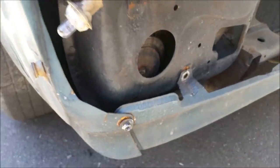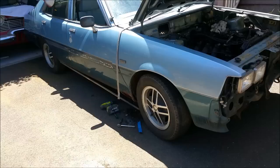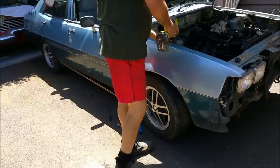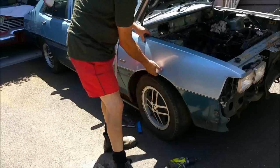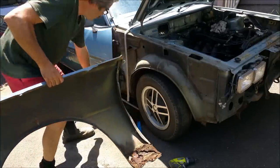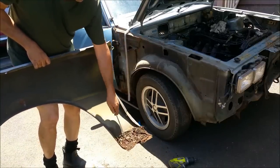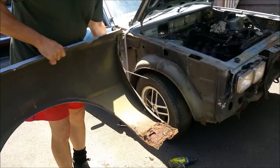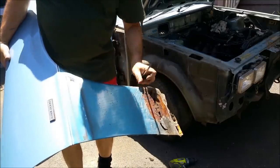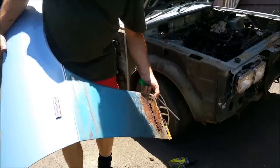More Tiger Yellow - so this Tiger Yellow car has obviously been in a biff and the parts have been put on this thing. We've got some rust here. I wanted to dig off the bottom of that guard and have a look. There's some rust there - I'll have to do a little bit of repair. But it's all pretty good. That's a bit messed up - that's pretty cactus. But we can fix that, it's not going to be hard. This means welding on a whole new bottom on it. Might be easier getting other guards in, but that's pretty rooted.